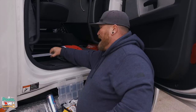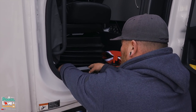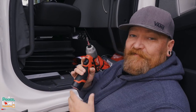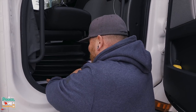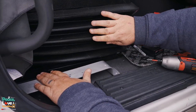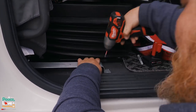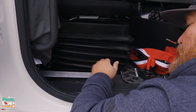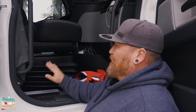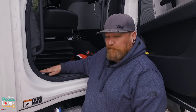We're going to be using some self-tappers to mount the bracket in. I'm going to try to go a little bit back so it is out of the way of entering in and out of the truck, but not so far back where you can't get to it. I'm using my handy Milwaukee tool - thank Heather for letting me get this, hashtag not sponsored. I'm going to mount this bracket all the way up against this kick plate so it's far enough out of the way of the door. We have already tested on the other side - the door will still be able to close with it right there. I made sure there are no airlines or electronics under here. The airline for this seat comes across under the padding to the back of the seat, so we are safe.